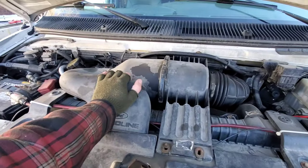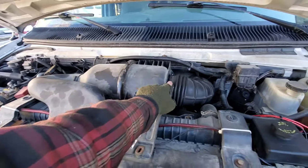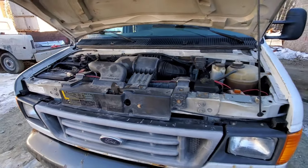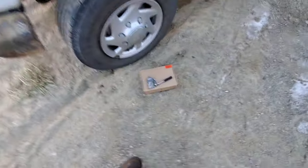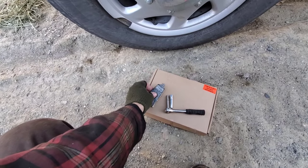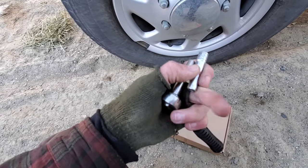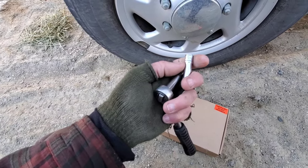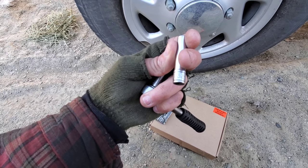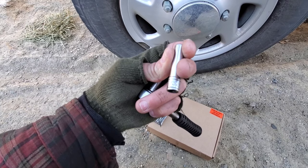The first thing we've got to do is get this air intake system out of here — take it all the way back through and off the intake. On the inside, we'll have to pull the doghouse. Mark wanted to point out that you're going to need dielectric grease and your coils. It's a 7-millimeter for the coil bolts, but a 9/32 will also work if you don't have a 7-millimeter.